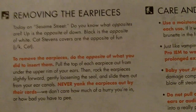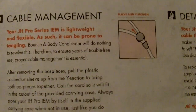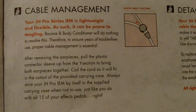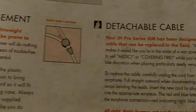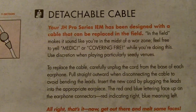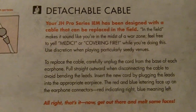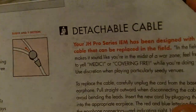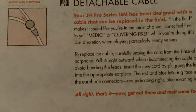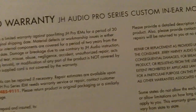Removing them is obviously the opposite of inserting them. You also have to handle cable management. For the detachable cable, simply pull on it — don't use too much force and don't apply any diagonal force by pulling it to the side. Pull it vertically, straight away from the earpiece. If you pull it to the side, you risk bending the pins, or even worse, the pins could get stuck in the socket while the cable comes out.